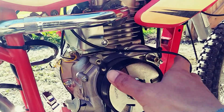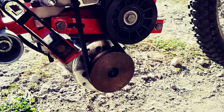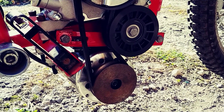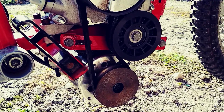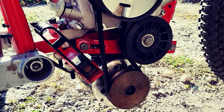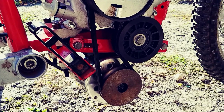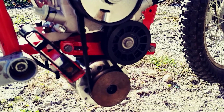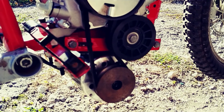Got a V-belt centrifugal clutch driving a belt down to the pulley on the DC motor, a.k.a. the generator. My generator motor is basically the biggest DC motor you can buy — it's a 1000-watt, 48-volt, 26-amp, 3000-RPM electric motor which now operates as a generator.